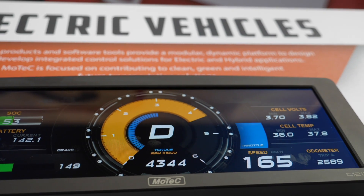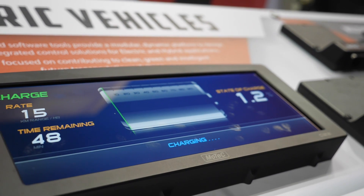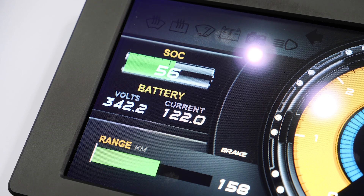In terms of getting those batteries charged — you're able to use regenerative braking, so essentially when braking the car drives the electric motor, turning it into a generator and recharging the batteries. You mentioned there's a limit to how hard you can charge those batteries — can you talk to us about the complexities there? Batteries are really difficult and really expensive. We're using an OEM battery from a BMW i8, and the trouble with OEM batteries is you don't really know the safe limits. You can't charge a battery as aggressively as you can discharge it, and the heat created is greater when charging quickly. So we can't take 150 kilowatts of power and shove it into the battery in every braking zone — it's a balance of watching temperatures and voltage, because when you try to charge a battery the voltage goes up and you can't exceed the safe voltage.